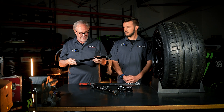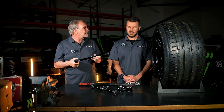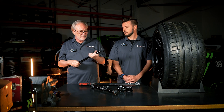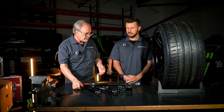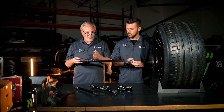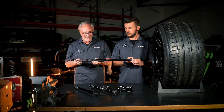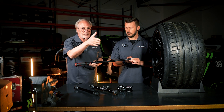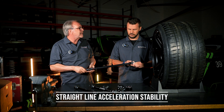I like to drive fast — I can't imagine owning a car without this. I don't like the rubber bushings when you put big wheels and tires on with a lot of grip, particularly with the torque modern cars make and how much suspension movement they have — I like the precision. If you're making a lot of power and one wheel has more traction than the other, it will actually flex the bushing and cause the car to steer or snake while you're accelerating. So this also adds stability when just accelerating in a straight line.